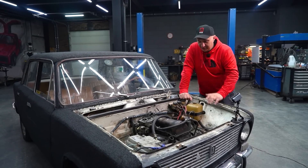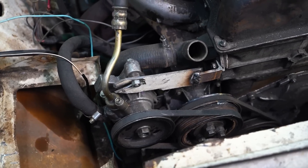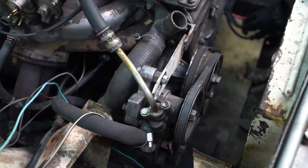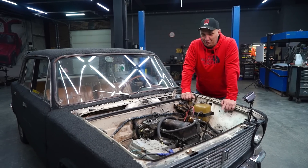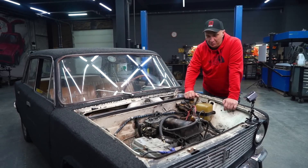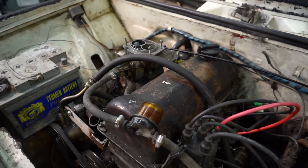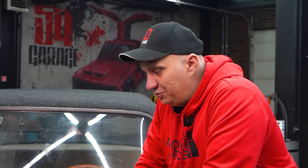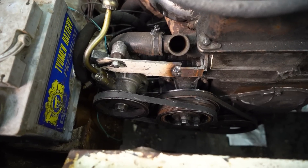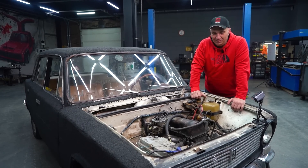Everything is going according to plan. We've redone the cam. As for the oil pump, we've replaced that with a power steering pump. The starter motor is unmodified. One problem we've created for ourselves is that now it'll only start with the box in reverse. We didn't flip the diff or anything. But we want to go ahead and try this out to work out whether we made any mistakes. So let's tie a rope to it — I really hope we can get the engine to turn in reverse gear without the wheels locking up. We're about to find out.